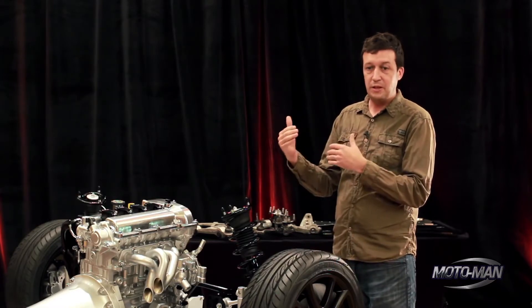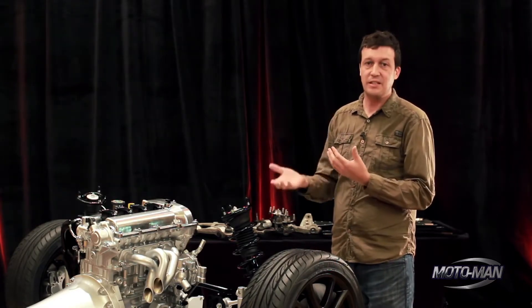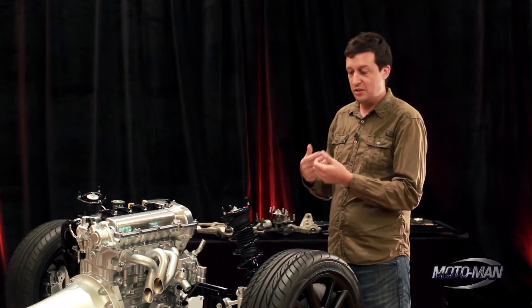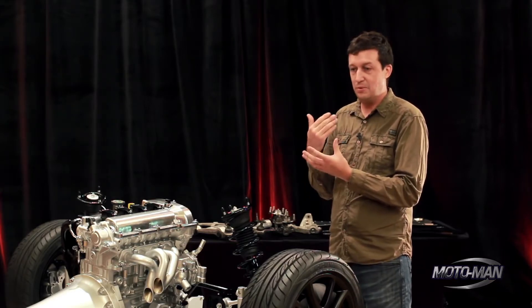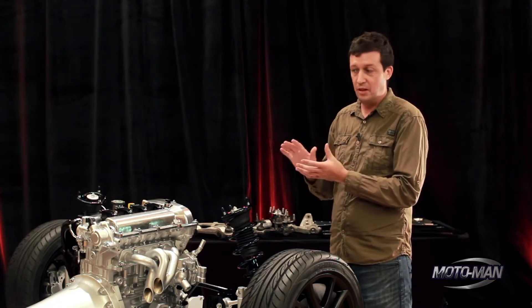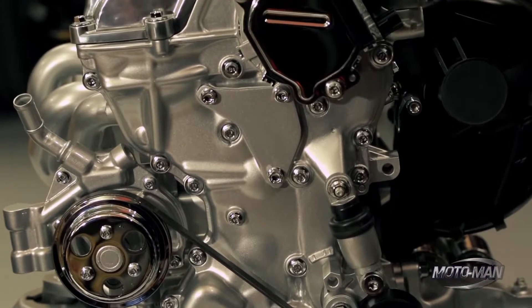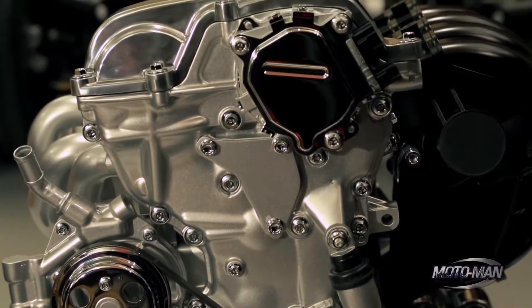Premium fuel is a lot more knock-resistant, and in a quick transient — when you snap the throttle open — that's when the engine is most likely to knock. So you have to make the throttle inputs a little bit smoother when you're tuning for regular gas. When we're tuning for premium, we can make it really sharp, so the throttle response is really strong on this.